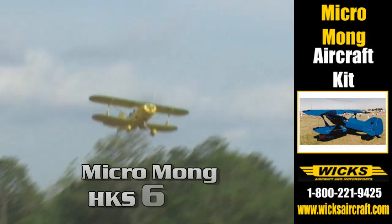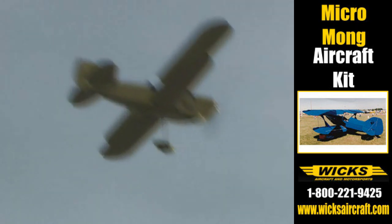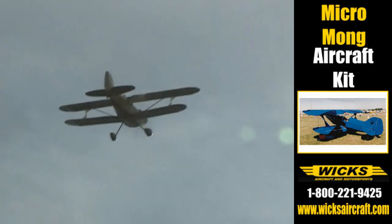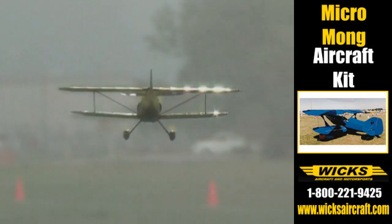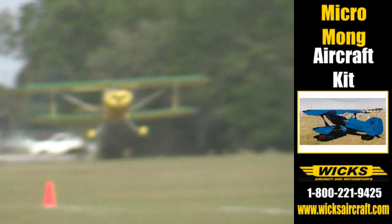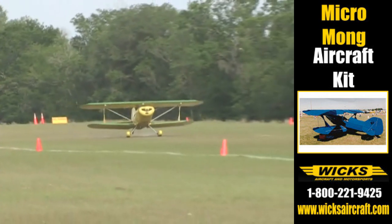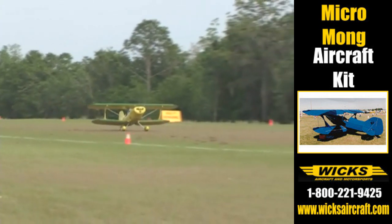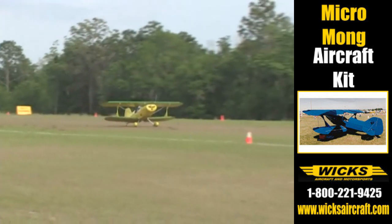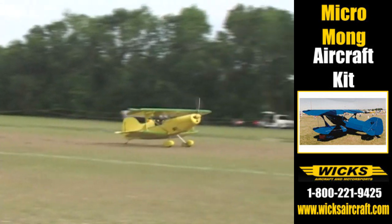What kind of horsepower are you using? This is 50 horse. What kind of performance are you getting out of a 50 horse on this? This one's quite fast — right now at about three-quarter throttle I'm doing about 105. You mentioned a 2SI engine — what model? It's a 460L50, liquid cooled. What type of reduction drive are you using? It's a 3-to-1. And what prop does that allow you to spin? I've got a GSC — it's a 60-inch.